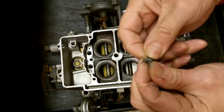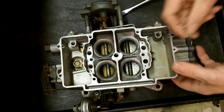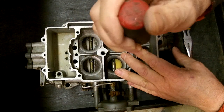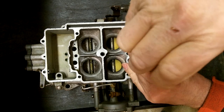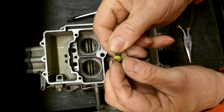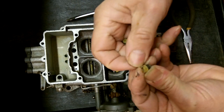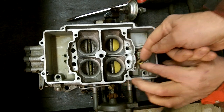These are the early kind — 62 it says. Now you're going to have the same size both on the secondary. If you're not sure about these, a lot of times on a lot of carburetors I'll wire together the two primaries, which is over on this side. I know this is the primary side — there are a lot of ways to tell, but one thing is it's got this accelerator pump on it. I don't know if I can see the number on these or not, but I'm sure they're smaller — 54 it looks like maybe, probably around 55. Make sure you get the same size on each end.